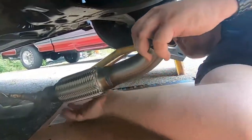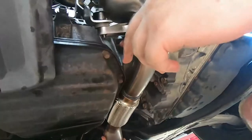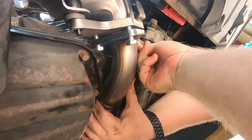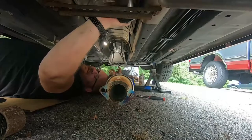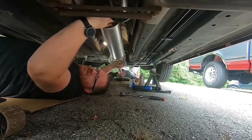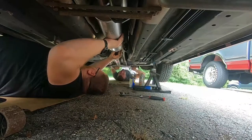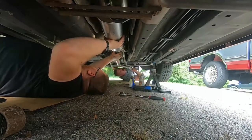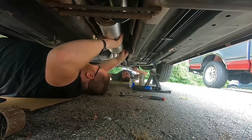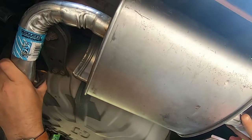Tighten the downstream O2 sensor down to 38 foot-pounds as well. Now we're getting ready to put on the down pipe — it's so weird how flat the Nissan down pipe is in some spots. You might notice a little difference: earlier I was putting studs in by hand, but at this point the nuts for the studs weren't going in well, so I switched to bolts which went in pretty easy. I do go back to the studs later. We're doing the rest of the down pipe and the Y assembly — Bob is down there mounting that end. We had a little trouble with the hangers; we had to take the whole assembly and push it upwards past the down pipe to get it on.